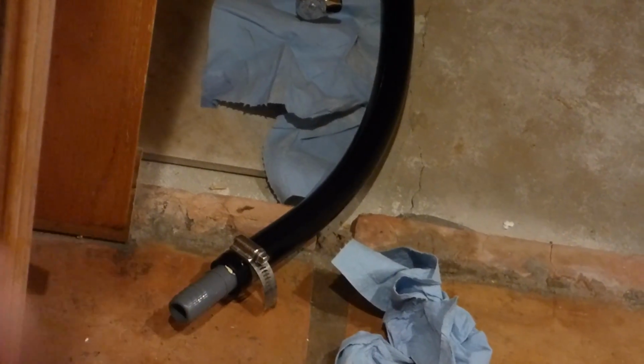Now, on the flip side, another trick is to use, I think, half-inch copper pipe. Copper piping looks a little something like this. Alright. Maybe if I, no, other way. Ta-da! Half-inch copper piping. This is from the old system. They had that gray thing down there, and this thing here, and this connected that 5/8 pipe perfectly. It slid right in there and connected them together, and then you clamp them down with the radiator clamps there.